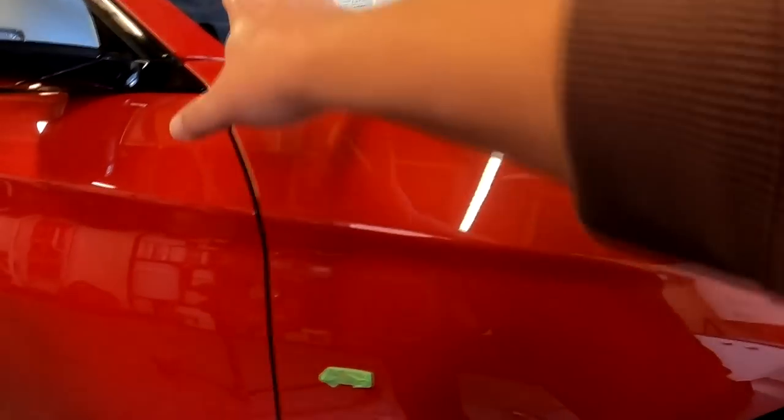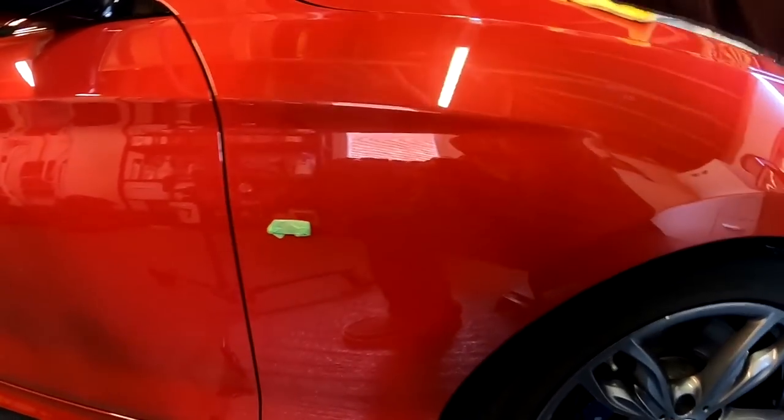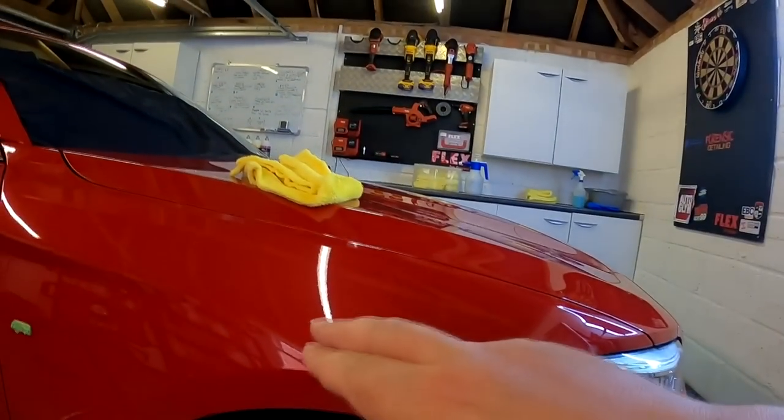So there you go, guys. Sometimes it's really good just to see polishing being done. I'm going to now repeat exactly the same thing on this area and do a very slow crosshatch section of polishing exactly like I've just done. Wipe down, and then effectively that wing is done. It doesn't take that long, does it? What was that, a five minute set, something like that, a four minute set, a long set? So you do 10 minutes on a wing and get really good results.